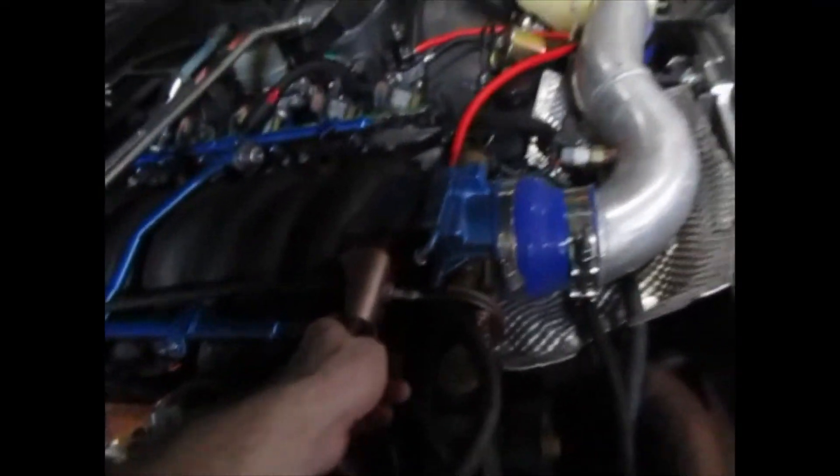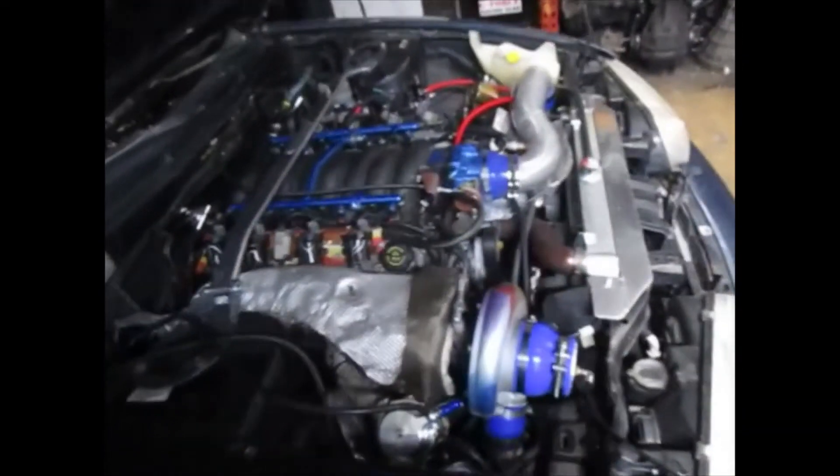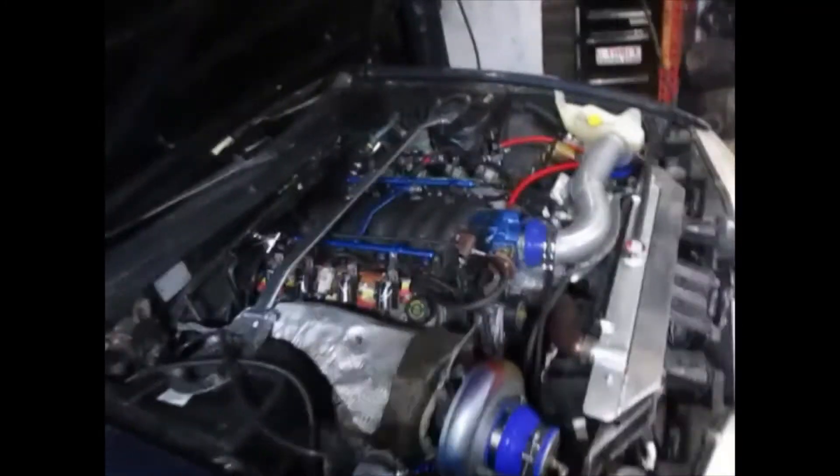So I had a boost leak — had a little boost leak. I knew it had a leak, I just needed to find it. Pressure test — absolutely necessary. Do not overlook.